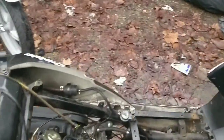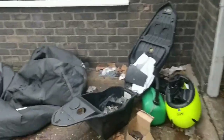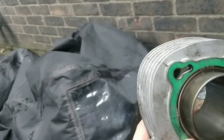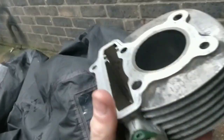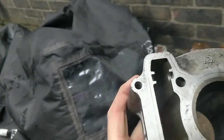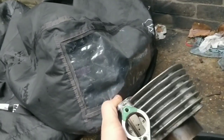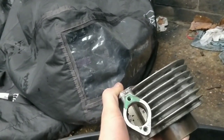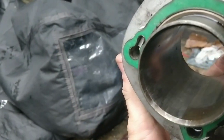But what I've done is I used CMPO, I think, and VMP to order the original parts for this bike, at least what I believe is the original parts, and I'm going to have to use the original cylinder, which I told you guys last time wasn't great. And it's not, but it's also not the worst ever. With new rings, it's probably workable. I think it'll be fine. I think it'll start and run and ride. This little crack is a bit nerve-wracking down there, actually, look. But again, I think we'll make it work.